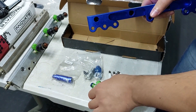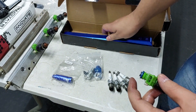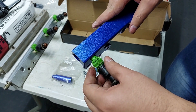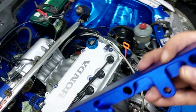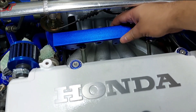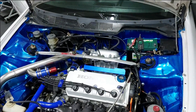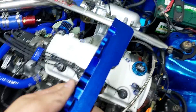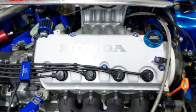These holes are a bit smaller, but I'm hoping that if I put a smaller rubber on here it will still fit, otherwise I'll have to drill these out as well. Let's take the new fuel rail and see how it fits. It looks really nice — blends in with all the blue around it, a very close match. It does fit, and these intakes only have two mounting points where the older P08s have three.